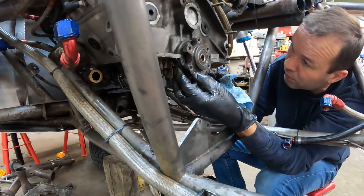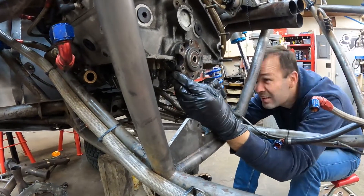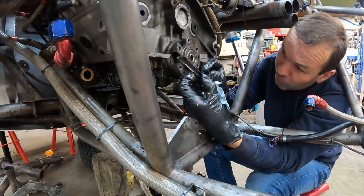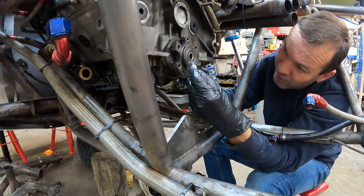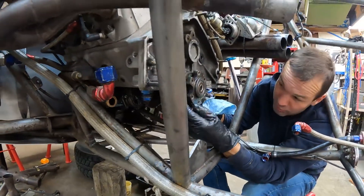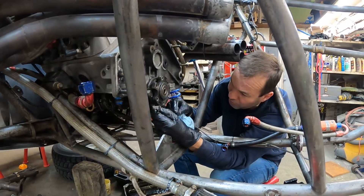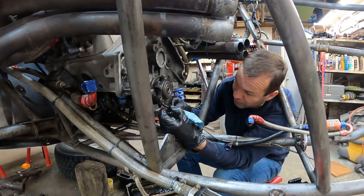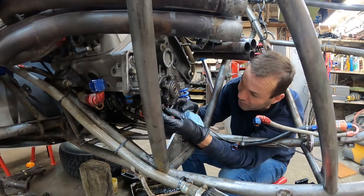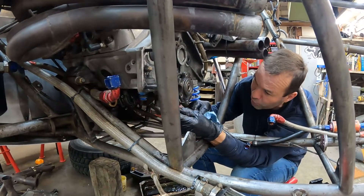Can you show that gasket? It looks to me like the backside of that gasket has actually deteriorated. So this is part of the pan gasket and this part is rubber - it's kind of starting to fall apart, probably due to the fact that it sat for 10 years and didn't get run a lot. The rubber kind of gets hard, it doesn't seal, and then a leak starts happening. Then it needs to be taken apart and a new seal put in.